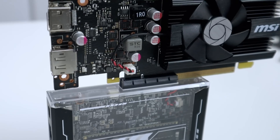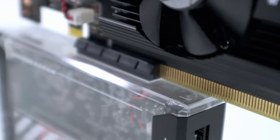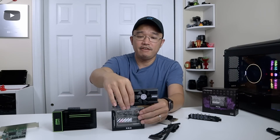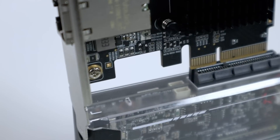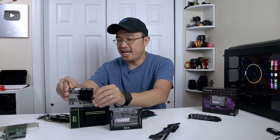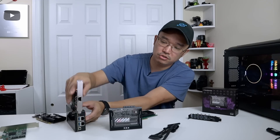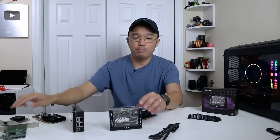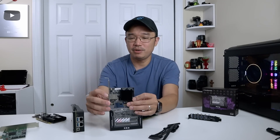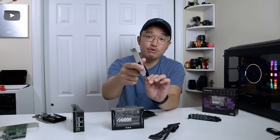You can see the card has a slight slant, but you can lift it up so it sits perfectly, and there's an exposed backing so you can fit 16x cards and still use them. If you try to fit a card with a back plate, it won't sit properly because the case is slightly too large. With the Zima Board the fit is very snug, but the problem there is it blocks the DisplayPort. That's not an issue with the Zima Blade, though you still need to remove the front plate to get the card to fit in the slot.